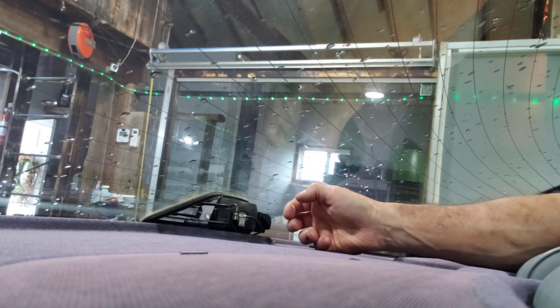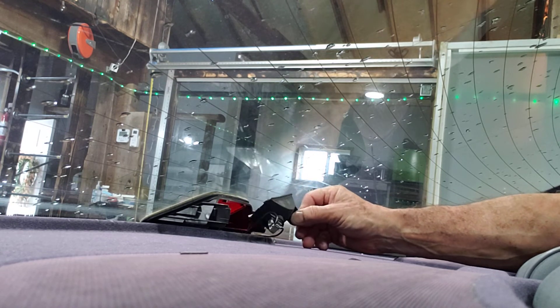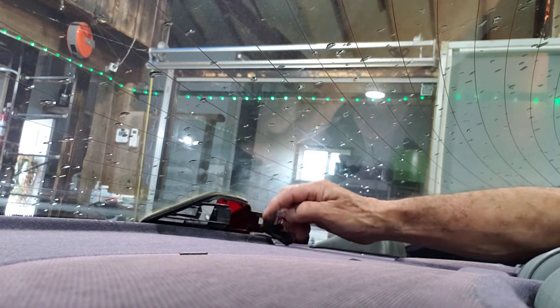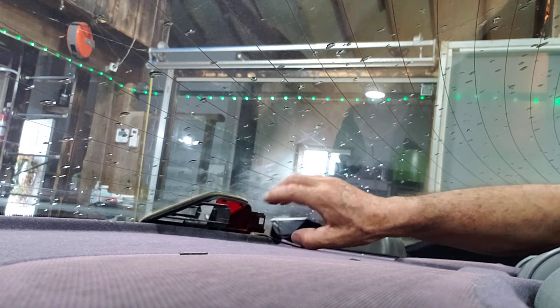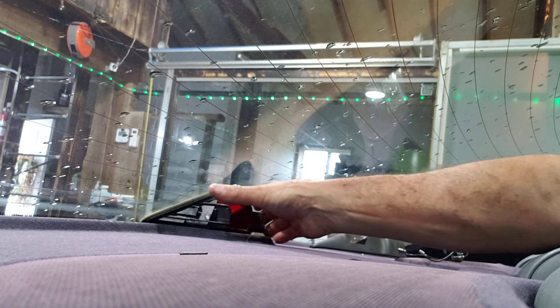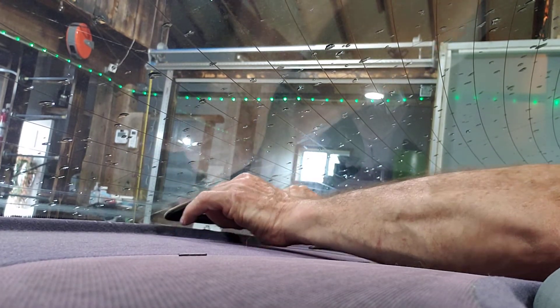Now to remove the whole light you can pull it towards you, but sometimes it's hard. It's easier — there is a tab over here that if you pull that way, it unlocks. This little piece comes off, and the two little wires are very easily detached over here — you can just pull them in your direction. They usually come off easily. This is the power cord.